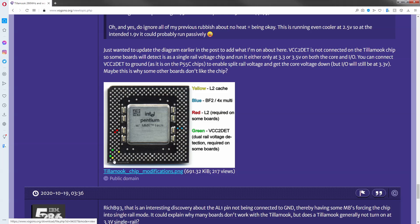The yellow modification fixes a bug where the level 2 cache was not working with this processor, so I consider both the green and yellow ones mandatory. The blue one simply unlocks the 4x multiplier. Finally, the red one may be needed on some motherboards but can cause others not to boot, so I would start without it and only connect it if the system fails to boot.